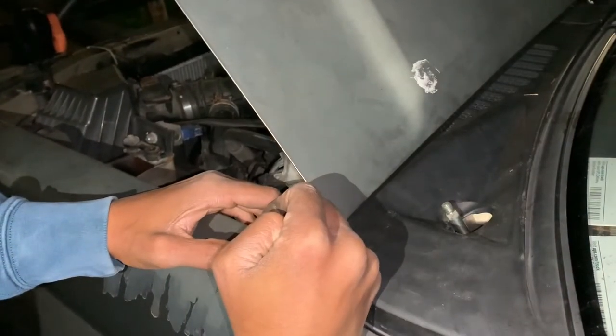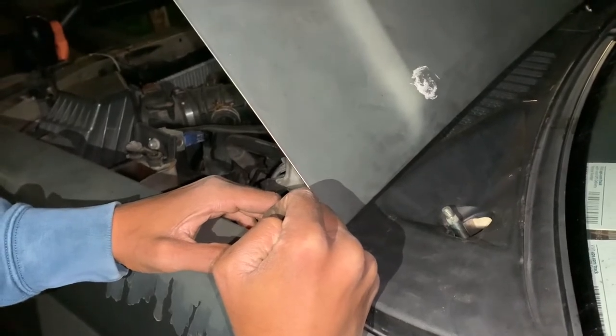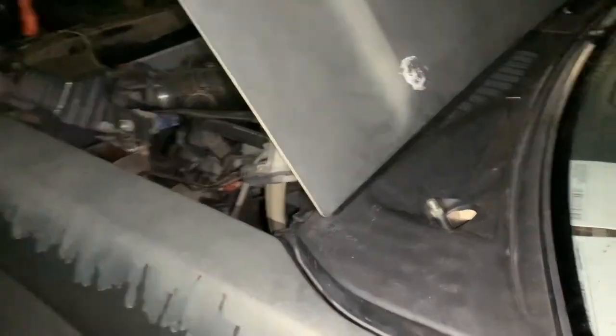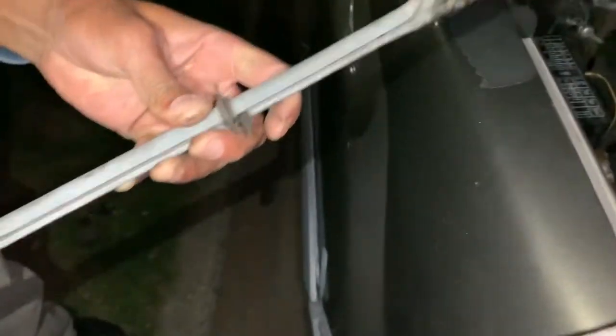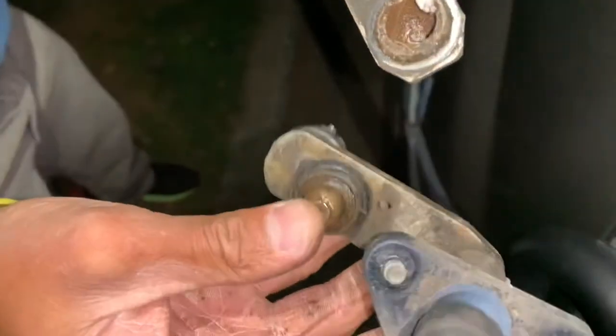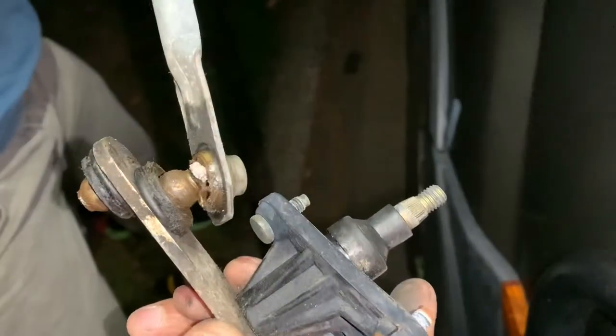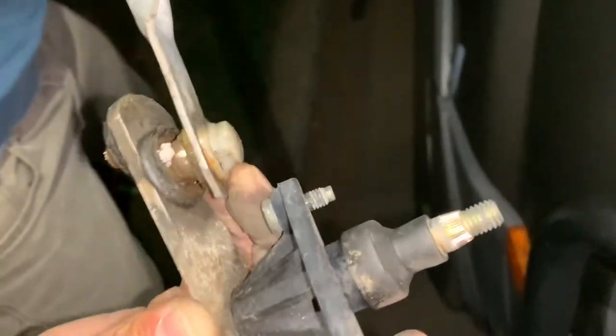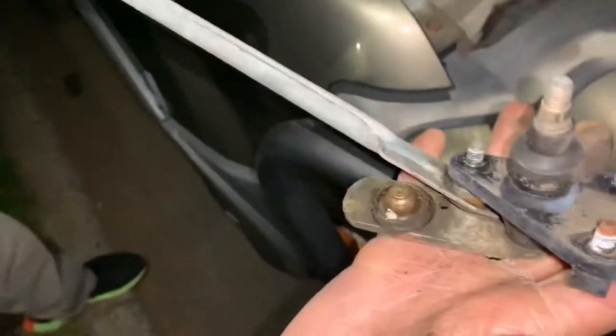I thought I had the wiper motor burned, but that wasn't the case. The motor was moving but the transmission was the problem. This middle part of the transmission just snapped out, so it wasn't holding itself. When you turn on your wiper, all you heard was a growling sound and the wipers weren't working — it was the transmission.